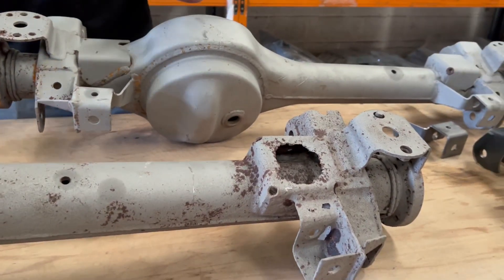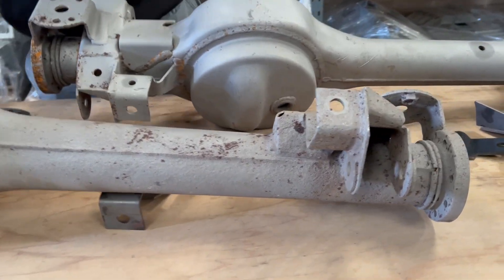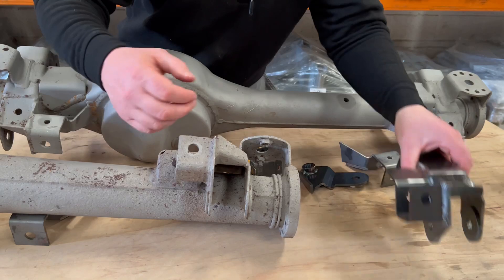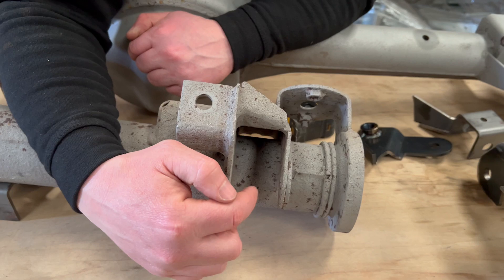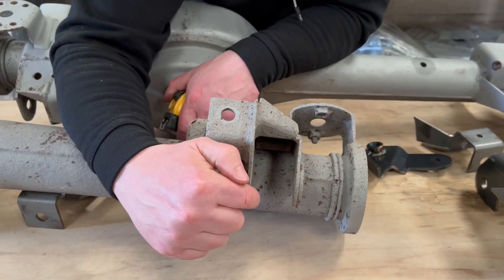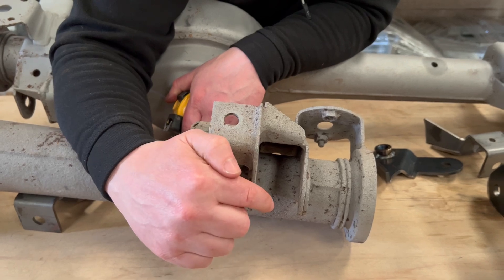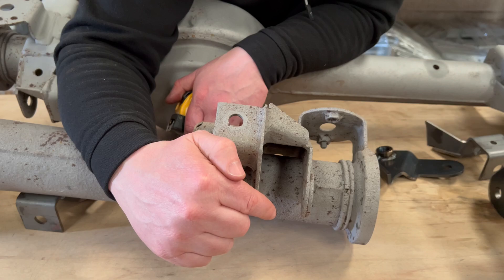The other difference is on your ADS arm — we call this bit your radius arm here, it's what your radius arm bolts on to. What we're looking at is the inside measurement. When you go on the website you'll see an option saying do you want a 47mm or 54mm, and that's referring to this inside measurement. The 47mm and 54mm also denotes what year it was: 54mm is 300 TDI onwards, and 47mm is up to 200 TDI, so you're talking 1993.